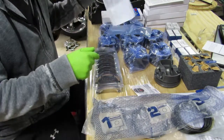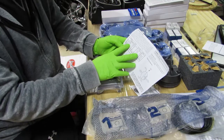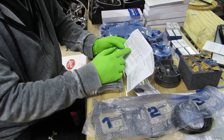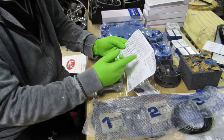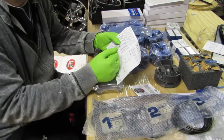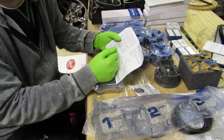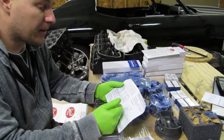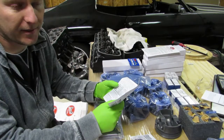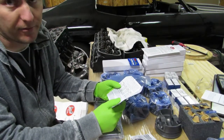Molly gives you the instructions — it's pretty straightforward. It says street and strip use, here's your multiplication factor for that. If you're using nitrous, you're going to have a bigger gap. It says the second ring should be tighter than the first ring. But if you look on any other engine, the second ring always has a wider gap than the first one.